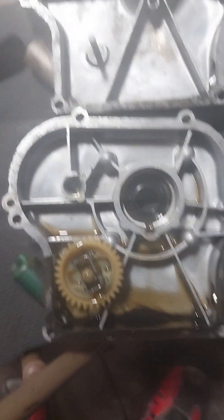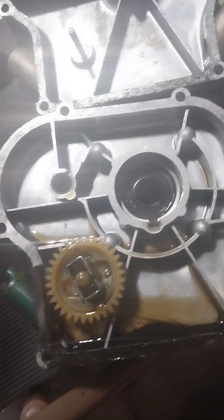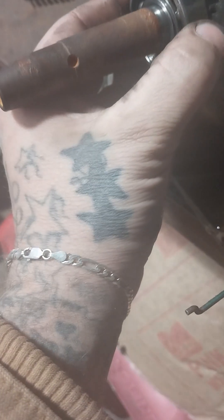I don't know if this is going to work - look at the side cover difference on the crankshaft. What do we have to put that side cover on back here? Look at that, guys - I don't think that side cover would work on there. Somebody already took the governor out, that's probably what happened to the springs. That one's got a seal, that one doesn't have a seal. That one's got a bearing on it inside - there wasn't a bearing on the other one.